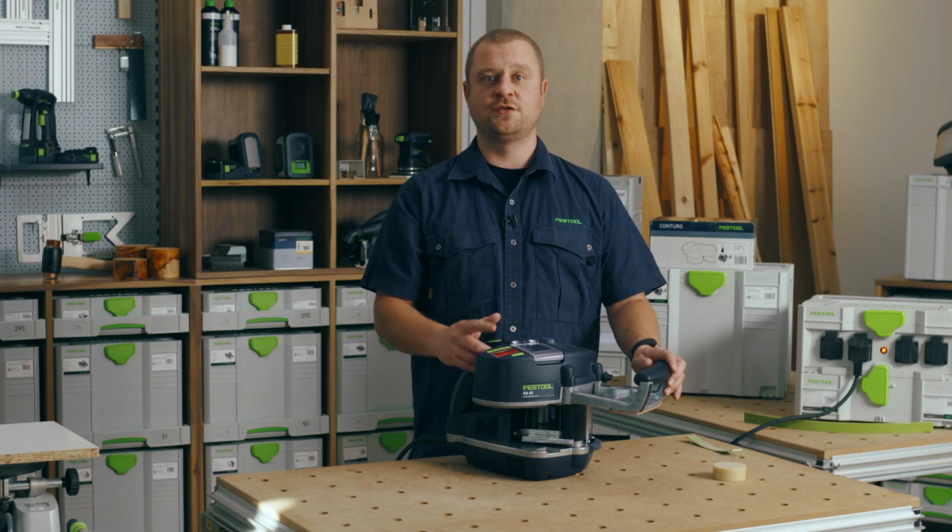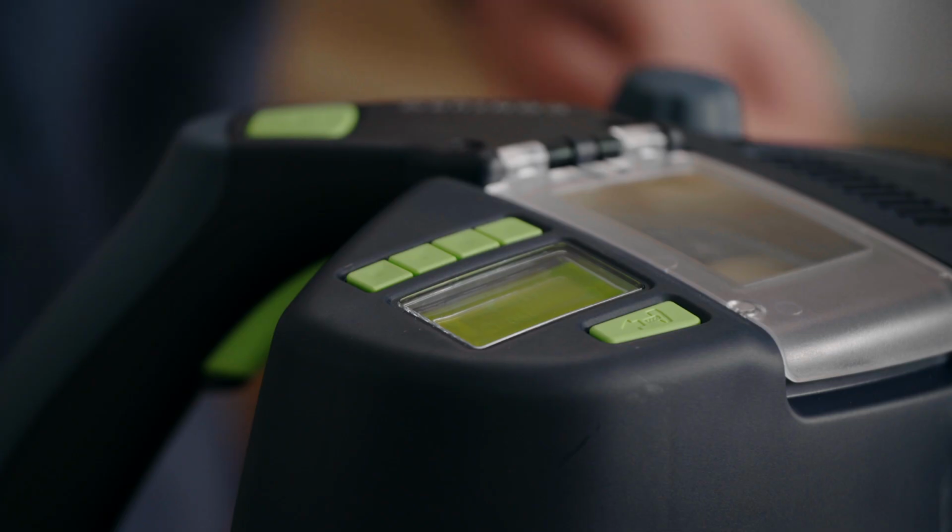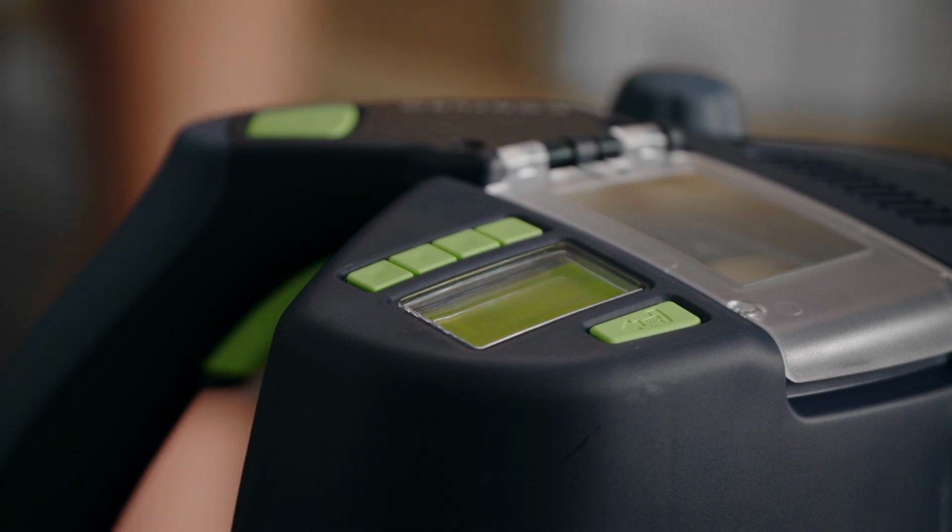To prevent damage to the CONTURO, it is important when the display screen is red or flashing red and green that no attempt to forcibly adjust the height setting dial is made. The height adjustment should only be made once the screen is constantly green.